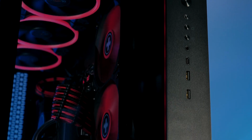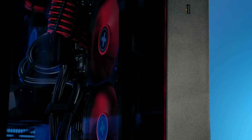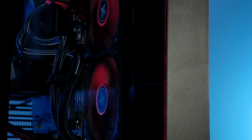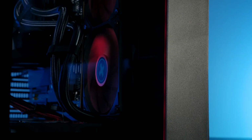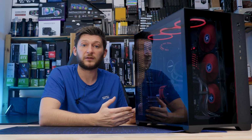It has excellent cooling capabilities, and you will find the exact numbers in the building video for this puppy. But overall, you can build damn beautiful and good systems in here. The only thing that I would note about this is that this is clearly a water cooling case. You can do air, you can always do air, but you will never get to the level of a 360mm AIO given the not even 150mm high CPU cooler restriction, and the fact that nothing will logically function as a good airflow path in here.